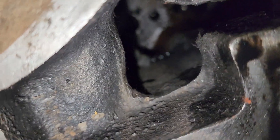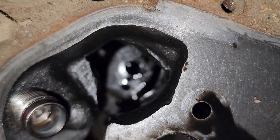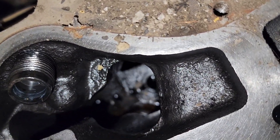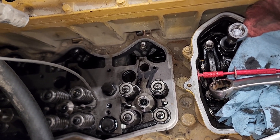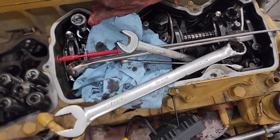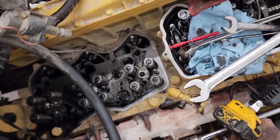You can see that little black dot which I can't get focused in there very well. Yeah, there are some locks down in there — those are bad. I can't really get a good view on it. Now I'm going to have to take this other part out because that lifter is just stuck and it's sitting sideways. Odds are it's probably damaged the cam, so I'm going to pull the rest of this off and then we're going to prep to get the head off to check the cam out.